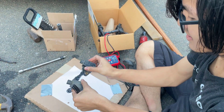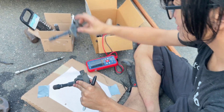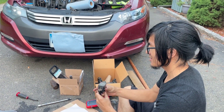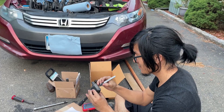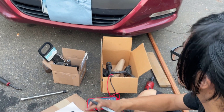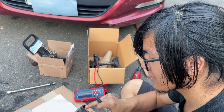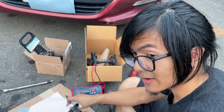Notice where the bolt holes are in respect to the cable port — you just want to keep a note of that. One thing you want to do is just label them to make sure you don't lose track of them. So we'll write one on the top of this one. We're going to go through each and every single one of these ignition coils to check their prongs.